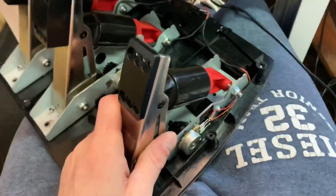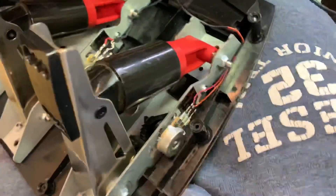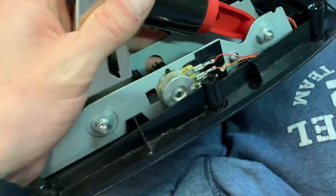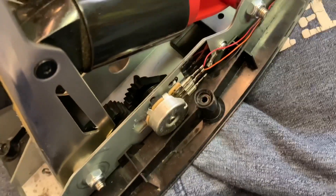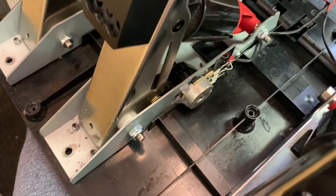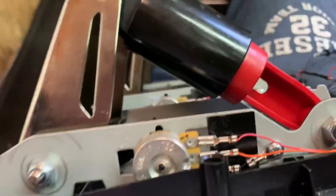This is part two of my potentiometer fix. I still have issues even after dismantling them, cleaning them out, and doing a decent job on them. They worked for a while and now I have different issues — when I'm on full throttle, sometimes it's not giving me full throttle and it's bouncing up and down. It's also affecting the brake. What I think is happening is the potentiometer has slightly moved.